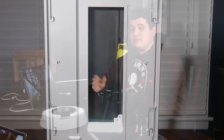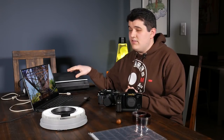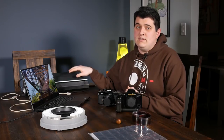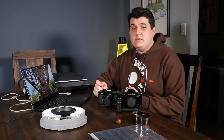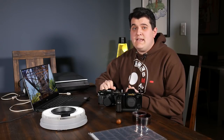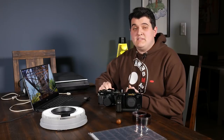Film scanners are also separated from their document brothers by a very high-resolution scanning array. This scanner's sensor is capable of resolving 6,400 pixels per inch, meaning it can produce a theoretical image with dimensions over 6,000 by 9,000 pixels from a standard frame of film, or an over 54 megapixel image.